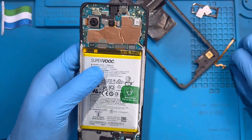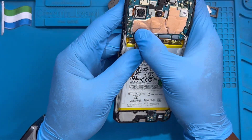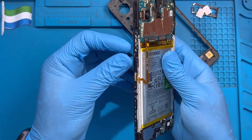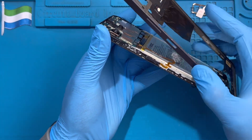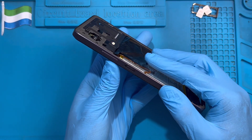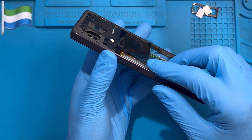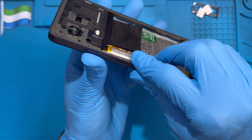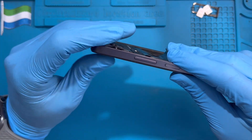Fix the fingerprint cable back. Make sure you get the alignment right before you press it down. Make sure the button is on top like this. When you try to close the cover, fix the button side first before closing the other side — you cannot force it closed. Make sure the button is inside and corresponds very well.